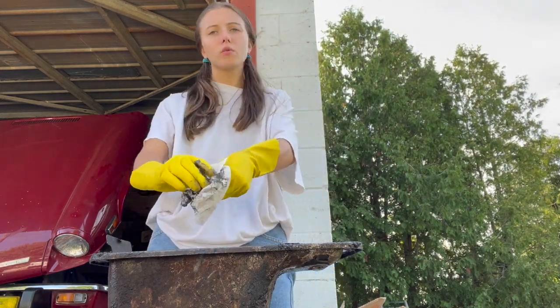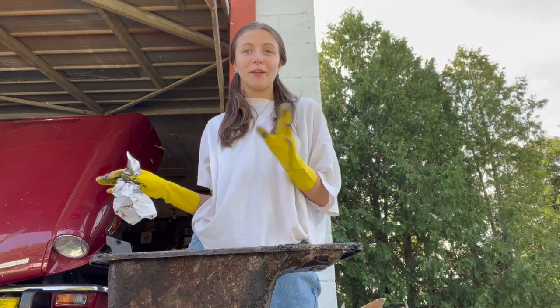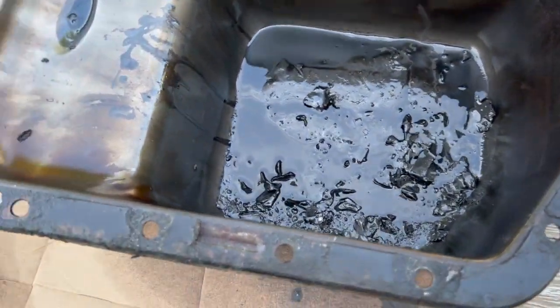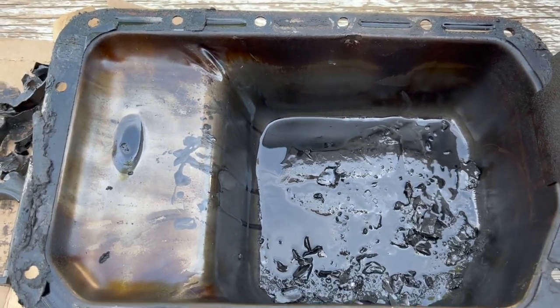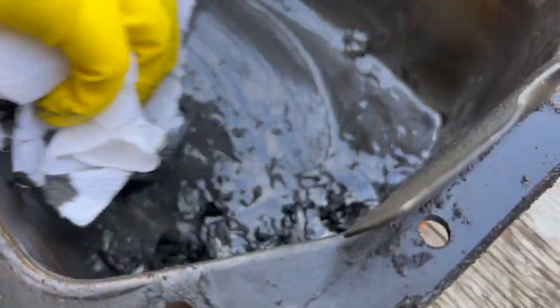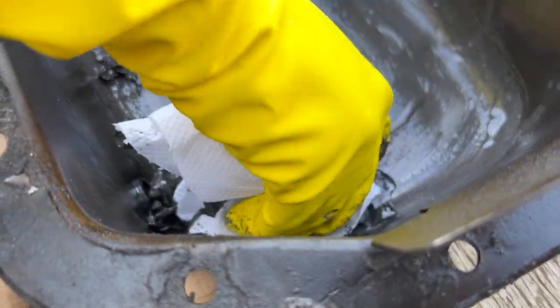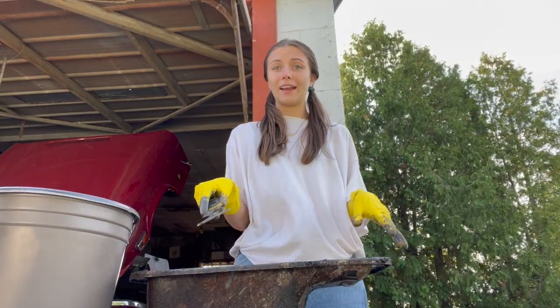Next we have the big end bearings — these are just totally not right. Also, side note: probably worst choice of shirt and pants, but it's okay. Those are all the important bits. The rest in here is just little bits we don't need to look at. Here is what it's looking like right now — there's obviously still stuff in there but it's not going to be helpful to us. Here are all the bits I took and cleaned off. Now I'm just going to wipe this out and give it a good clean — it is super sludgy and thick. Next I'm going to scrape off what's remaining of the gasket.